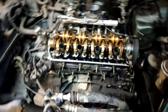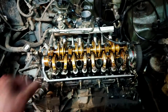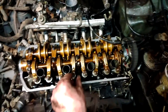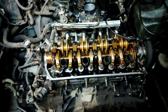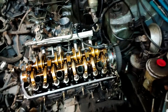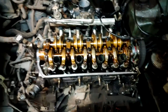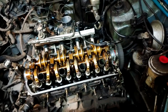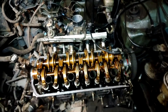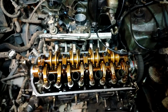This poor Civic. I did the compression test and three was still zero. One and two were about 60 and four was about 60. Then I realized something — the valves were extremely tight on cylinder three, and that would definitely explain why the exhaust valve burnt. I'm guessing someone did a valve adjustment and didn't do it correctly, tightened them too much and burnt a valve. So I just did a valve adjustment on all four cylinders and now they're all at about 75 to 90. I'm at altitude — 5,000-some feet — so that affects the compression test readings, and this engine is stone cold because I just put it together. But I think that's good enough to move on.